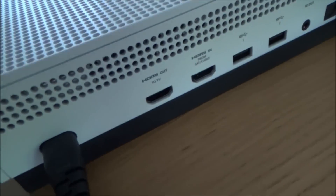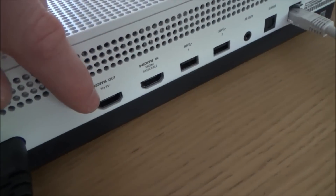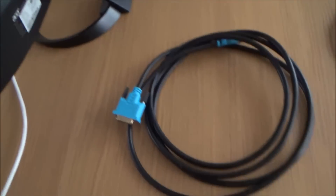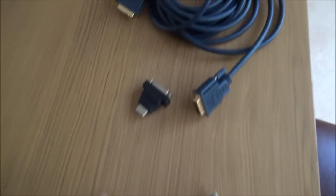It's easy to do even though the back of the Xbox only outputs HDMI, so you haven't got any DVI to plug into. But it's fine — they're both digital signals, so you don't even need anything to convert the signal. All you need to do is get yourself either a cable or an adapter depending on what setup you want.